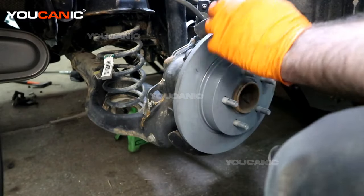The brake pad with the two dots straight up and down goes on the outside on this model. The one with the dots and spring mechanism goes on the back side. Because this model doesn't have an electronic parking brake, the smooth side goes on the back. If it had an electronic parking brake, those dots would line up with the corresponding holes on the piston.